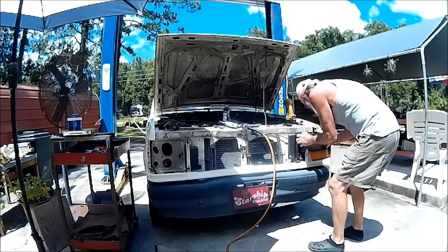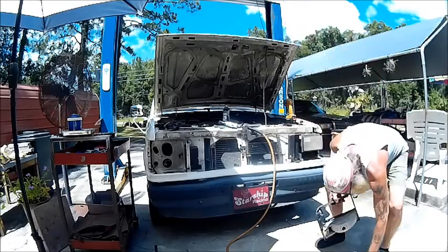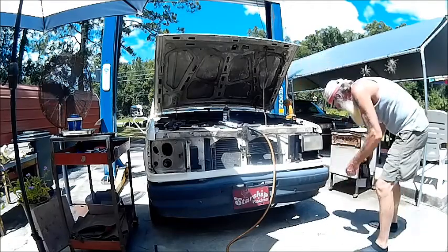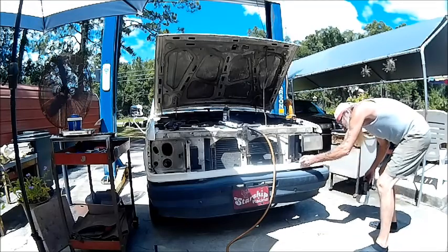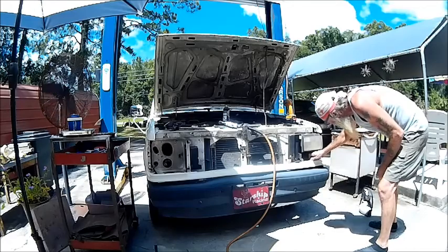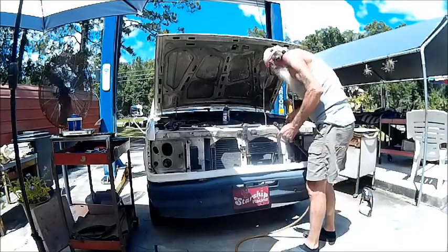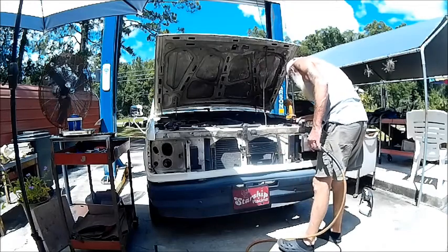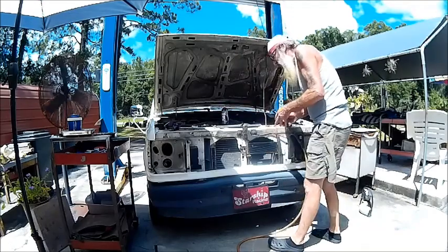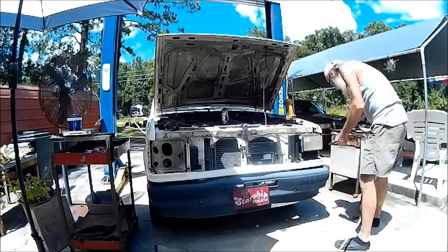For the body being a little blacked out, that's what happens. These clips get so rusty they like to hold on to things. I can pretty much see here the body is a little up. I'm going to hit that with a rubber hammer just to drop it down just a little bit. I might loosen a bolt in there. Use a little bit of penetrating oil on these here. The slotted ones are a little harder to get at, but they don't get that crazy rotted up either. So these come off — it's fairly easy.